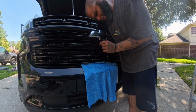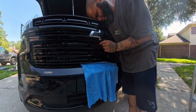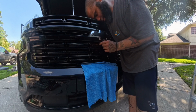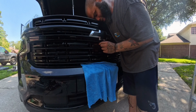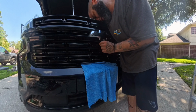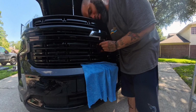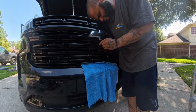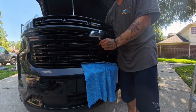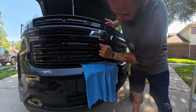and again, it's a little hard because there's a bar right there behind it. That's what made it so difficult to get it off. But once it's in place, it rotates. Once you feel you have it on, rotate it to the right position till those clips are interlocked, and it'll snap. Once they're interlocked, it'll snap. And now camera's in place. It should be right there.